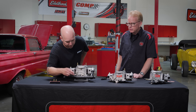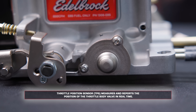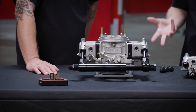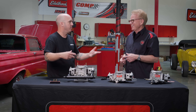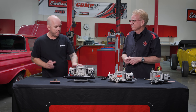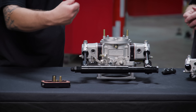There's also a spot for a TPS sender — that's one of the features. We have the provision for the TPS sensor right here under this cap, and it's a standard GM three-wire TPS that bolts right on. A guy running a 4L65E needs a TPS signal from somewhere. The carburetor isn't going to give him one traditionally, so instead of running cables and a box and all that, we just plug a TPS in there and connect it.